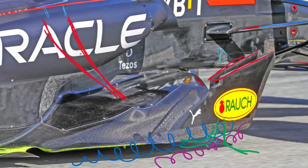This could be useful in terms of managing the tyre wake, which is going to come down along here, and this jet should help push it outwards. This should keep the tyre wake a little bit more out of the floor, and if we can keep that wake out of the floor we're going to help with floor performance. The problem with this theory is we don't know whether this converging channel has sufficient power to generate a counter-rotating vortex — maybe both vortices are still rotating in the same direction. However we can learn quite a lot about which way the vortices are spinning by looking at the shedding edge details.